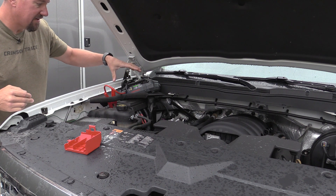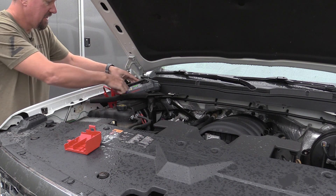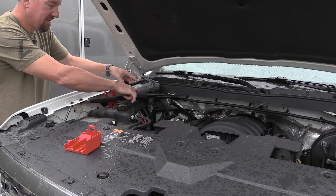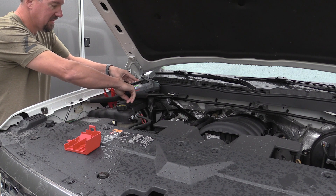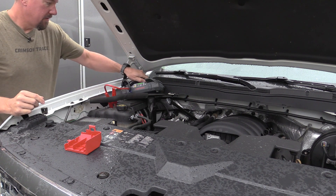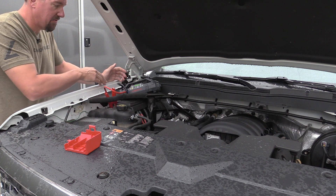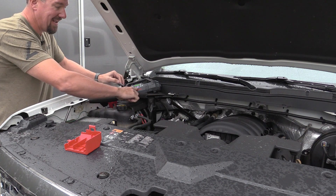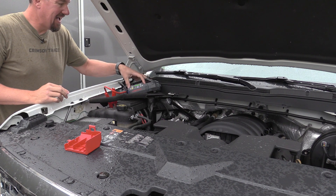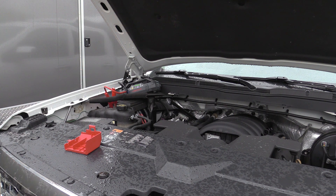It's actually in a charging mode right now, so it's going to tell us what is being put to the battery as it goes through. If we push the power button, that's the actual voltage of the battery — 9.7, 9.6, fluctuating back and forth. We push the power button again and it should turn on. Once it goes to its normal voltage, it was hard to get back on without reconnecting. We're currently at 11.8 volts with it pushing power in. The battery was at 9-point-something. You can hear it clicking on and off — that's just putting power to it. It says 1,000 amps, 2,000 max. Let's see if it'll start.